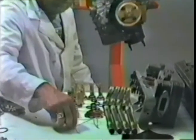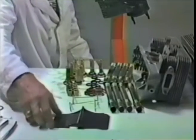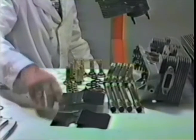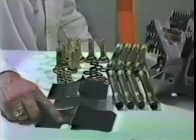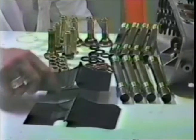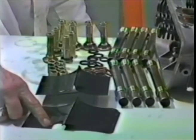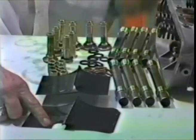Two of the retaining rings are for the air deflectors on both the number 3/4 and 1/2 side. And note the air deflectors are somewhat different. One has a square cutout, one has an oval shaped cutout. The square cutout's for the hex head of the through bolt, and the round cutout is for the acorn nut side. Now note if you put the through bolt in the wrong way, then these air deflectors will not function right, and they are somewhat different, so you do have to put them on the right way, which means you have to put the through bolt in the right way.